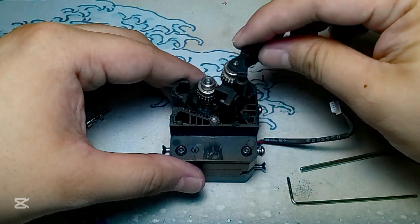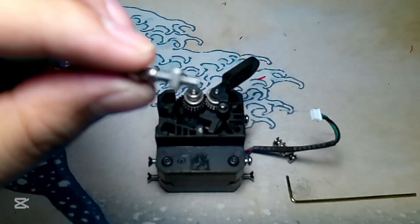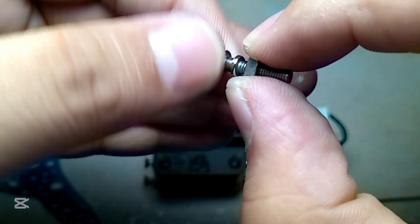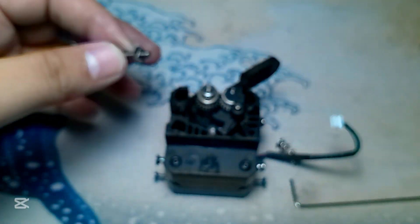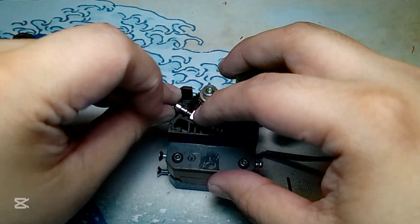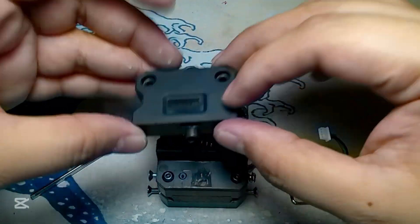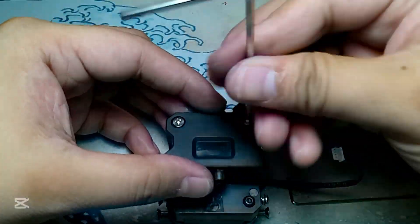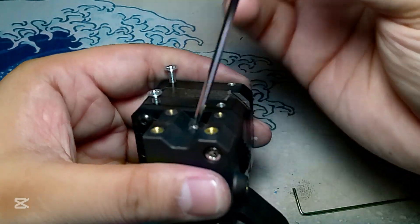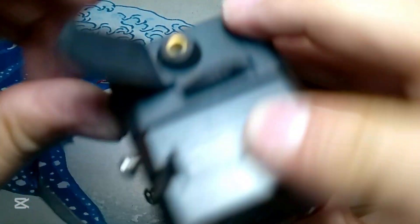Let's put it back: just put on the gear, the lever bar, and the spring and screw. This screw here specifically turns the other way — if you turn it right it loosens, turn it left it tightens. Let's put back the spring, put it on the lever. Make sure it is loosened before you put in the cap. And before you put it back in, make sure that the lever is tightened enough so the filament won't get loose.